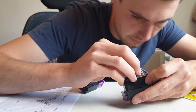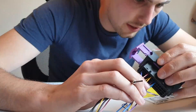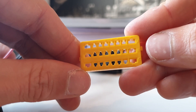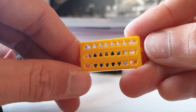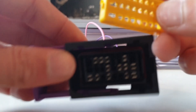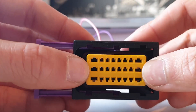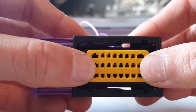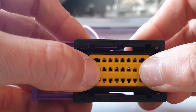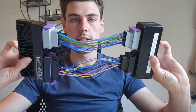I'm going to take the connectors and do the same for the rest of the harness. Once we've got all the pins in place we're going to take our yellow pin guide — as you can see it has A, B, C and then numbers one to eight along the pins. This will line up with your actual pins on the connector itself. Once in place, simply let the first connector click in and let the second connector click in and you're done. Once complete you should have something that looks like this.